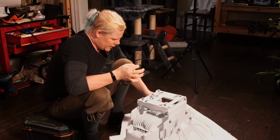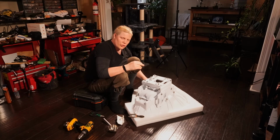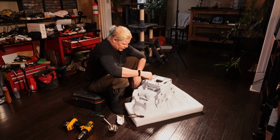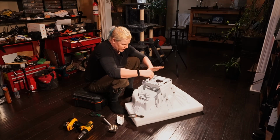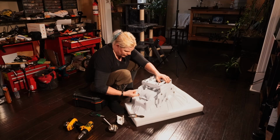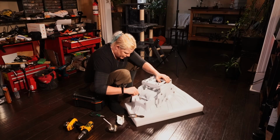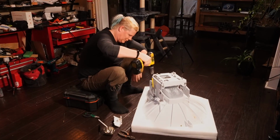So this little guy here inserts into the vibration mount, this rubber isolator that actually connects the cradle to the chassis. For that reason, the cradle itself is not actually grounded. It's not bonded to the radio. It's actually fairly isolated electrically from the tower itself. That's why it's critical to use the grounding lug when you have these things. Because if you don't, your stuff's probably going to go poof. You don't want that now, do you? Here we go. All right, whatever.